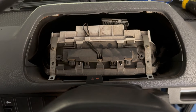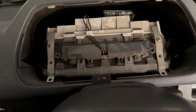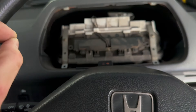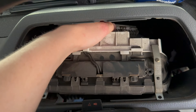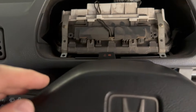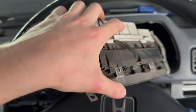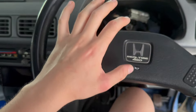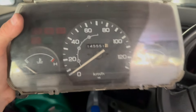Like right-hand Ron said, you kind of reach under the dash. I recommend getting the speedo cable out first — you can just pinch and try to pull it out. Then you can turn the cluster and get at the connector, push down, and pull out, and it should just come out. My hand's all marked up; that was a little bit of a struggle, but I eventually got there. It's out now, so we can try and do the swap.